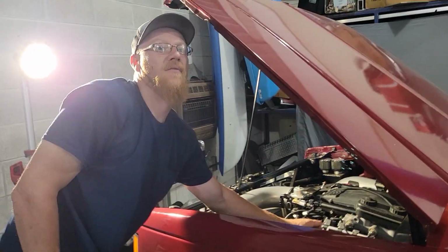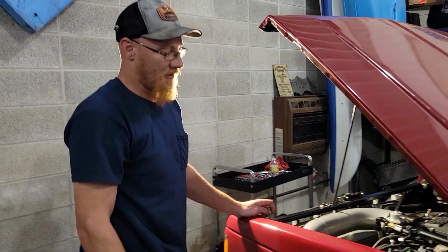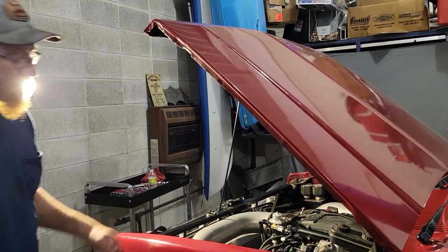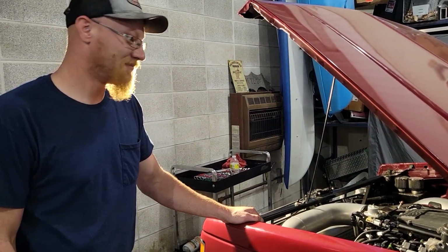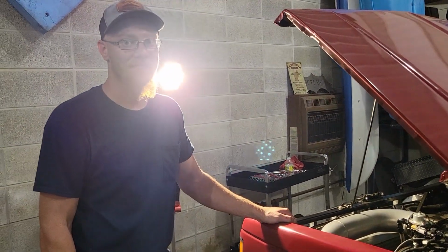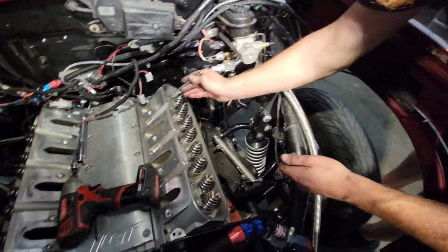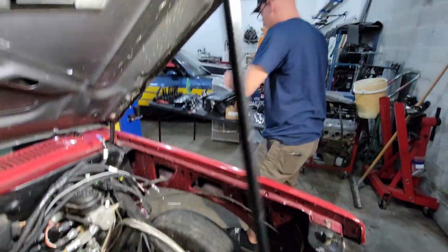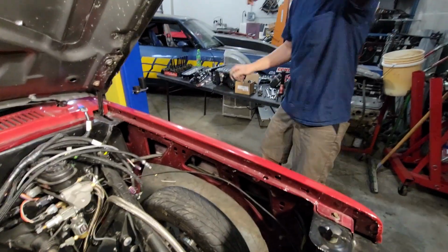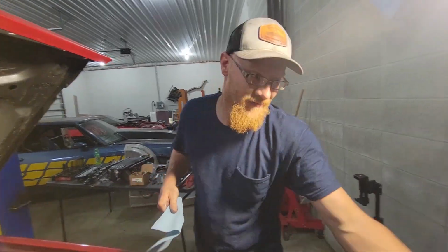So we know we have a leak somewhere. What we're not sure of is if it's the cylinder head or if it's the gasket. I've never seen a gasket leak enough water out the exhaust, but we have seen puddles out. We have seen cracked cylinders or cylinder heads do that to us. So that's what we're going to find out today. All right, we're just a few washers away from finding out the truth. Your dad pretty much is sure it's a head gasket. We're pretty much sure it's everything but a head gasket. Guess we're about to find out.